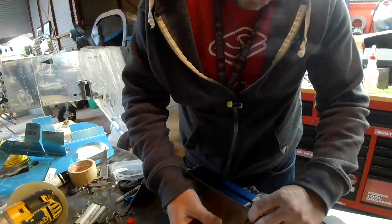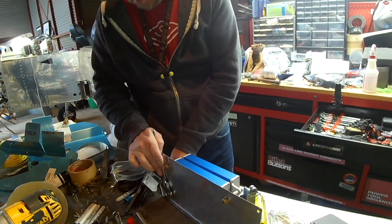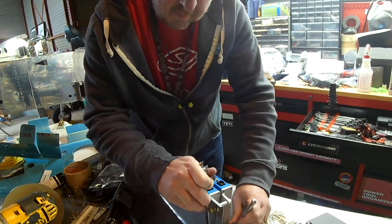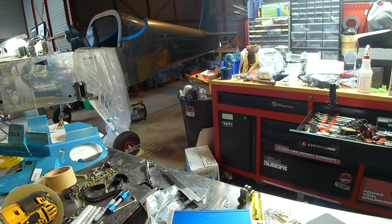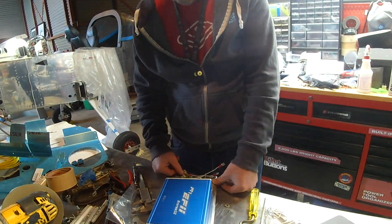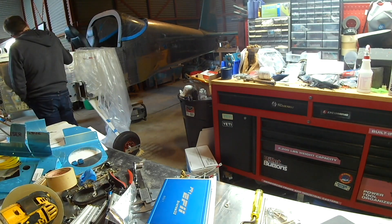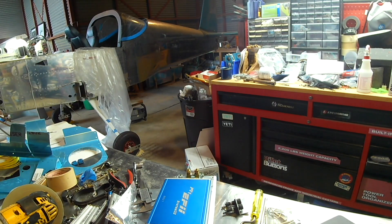The problem is the fuselage has a big U-channel crossbar across the top, so I have to stand the whole thing off. You can see the bottom of the boxes, and I've made spacers so that as the boxes are stacked on top of each other there's about a 1/8 to 3/16 inch gap between them for air cooling. I have to stand the whole plate off the firewall by three-quarters of an inch, using nut plates and bolts. Each ECU has quarter-inch holes and needs four bolts.